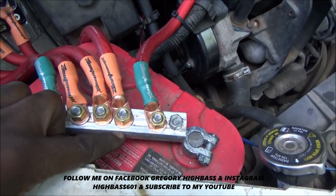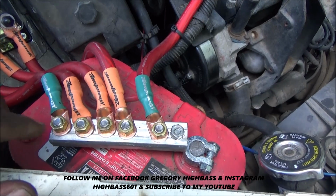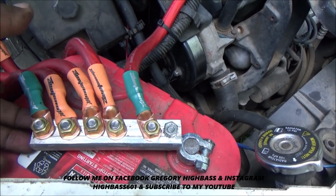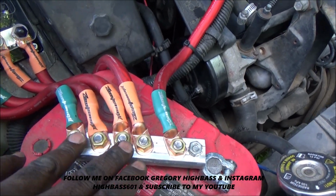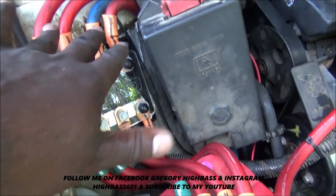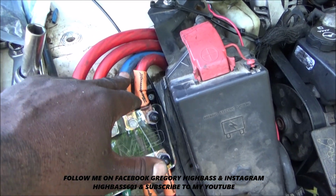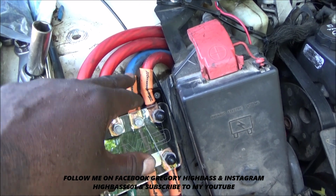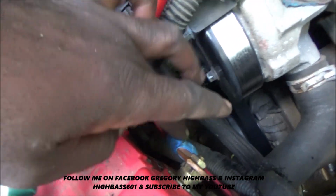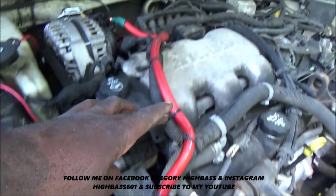So this piece right here, I already had this bus bar from last time when I had my AGMs connected to my Thunderbird. I just took my tool and cut it in half, in 4 runs from the battery to the SMD, and then I ran 3 runs back to his batteries in the trunk. Then plus this one right here was already in the back. Well, he already had this wire here ran. So he already had this wire right here also running from the alternator. So I ran another one from here up to here.